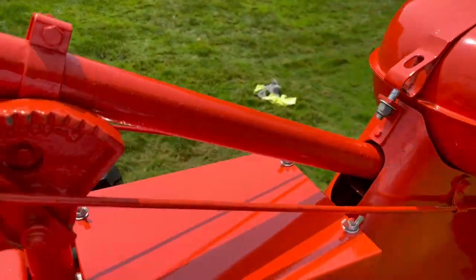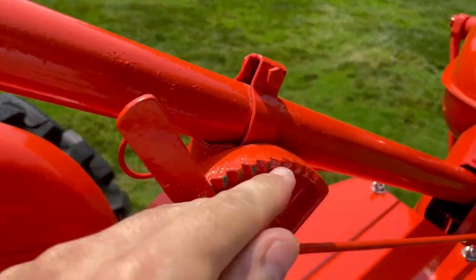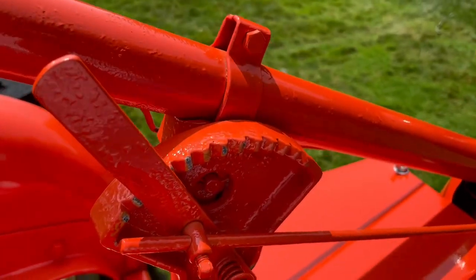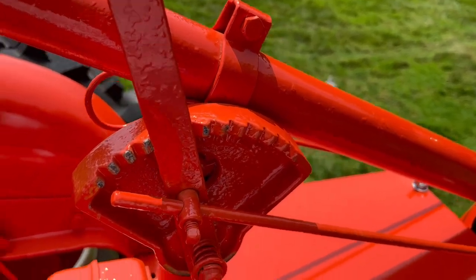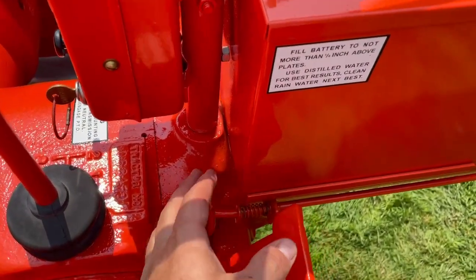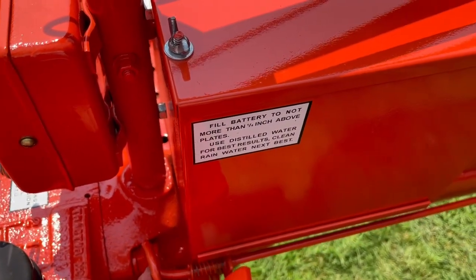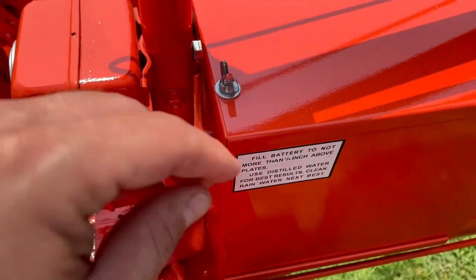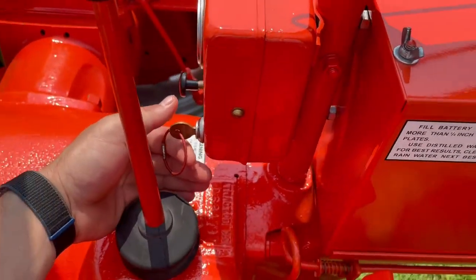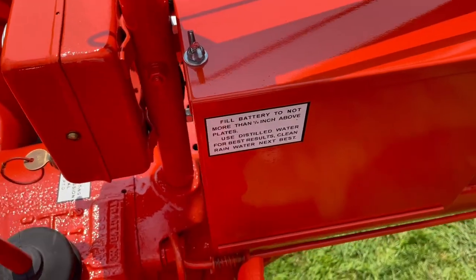I won't choke it. So the choke is in — that's choke, that's no choke. Like I said, this is throttle — it's high throttle and low. We're going to start it right here. It's out of gear. I'm just going to push the starter button, which is typically operated with your right foot. Once it's started I'll dial back the throttle to get it to a nice idle. So step one is turn the ignition on. We're out of gear — I'll go ahead and start it.